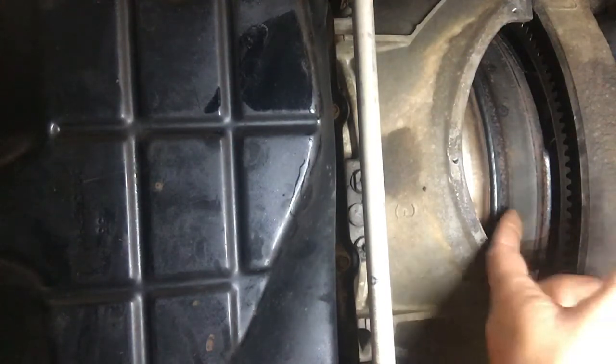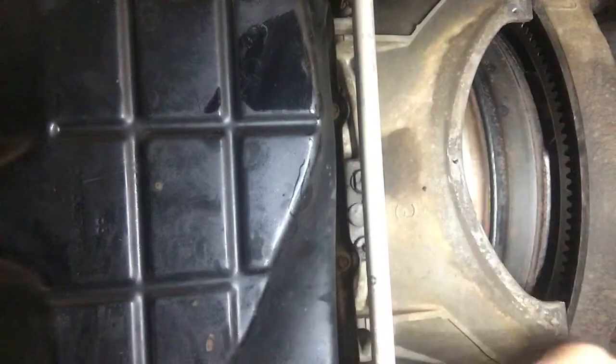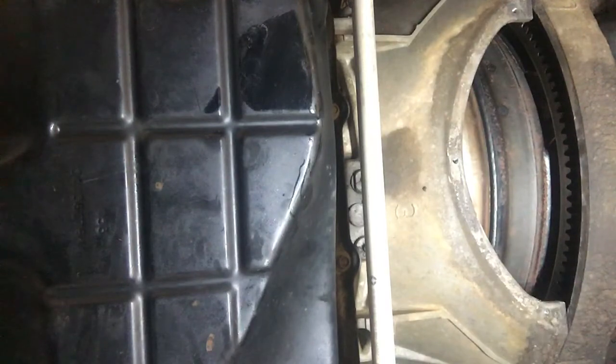But I think this warp occurred after my issue occurred. What I have is the adapter plate bolts in the top have backed out and are hitting all the torque converter bolts. Here's the sound you'll hear when that occurs.